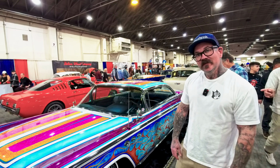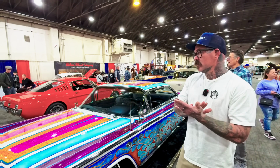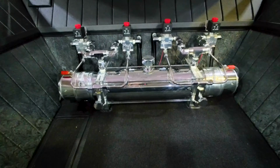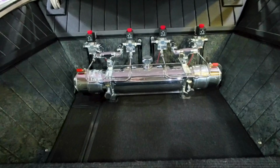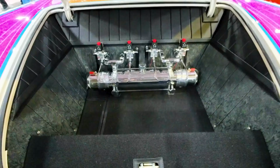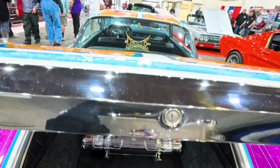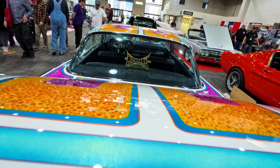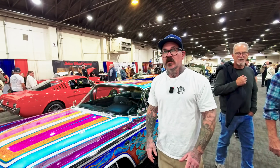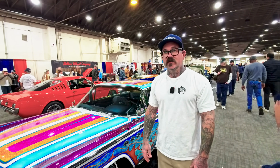So what setup you got? Two pumps for suspension? It's bag. All the suspension components were supplied by Red's NorCal. It's a 2-pump whammy kit with just 2 batteries. Everything's installed in the trunk, chrome, and the whole trunk's upholstered. Just 8s in the fronts and 10s in the rear. No accumulators, just a simple, old school setup. Nothing crazy, just clean and it rides nice.